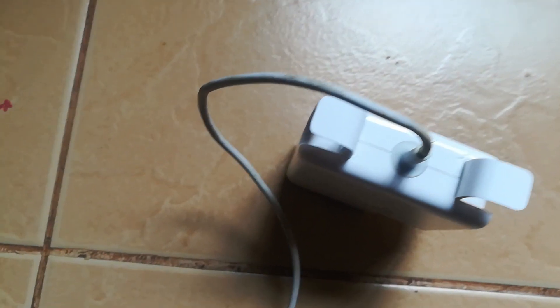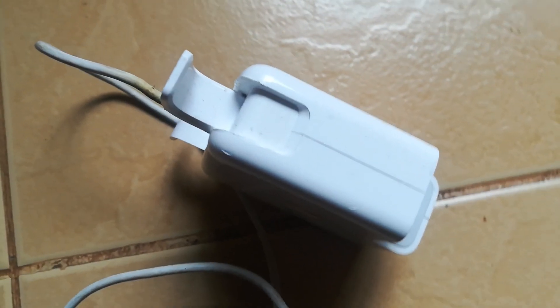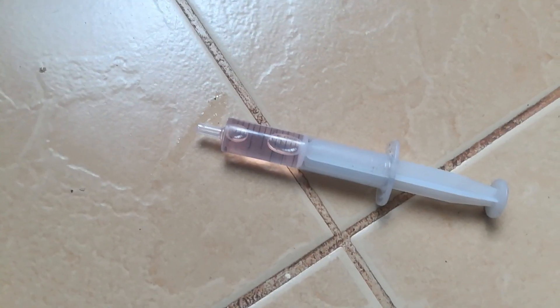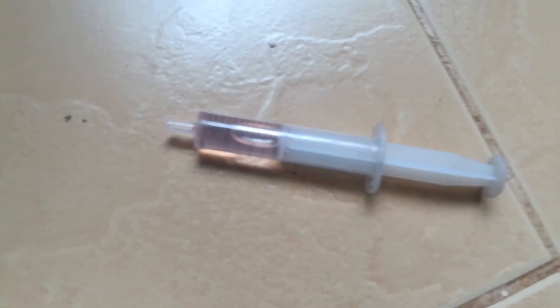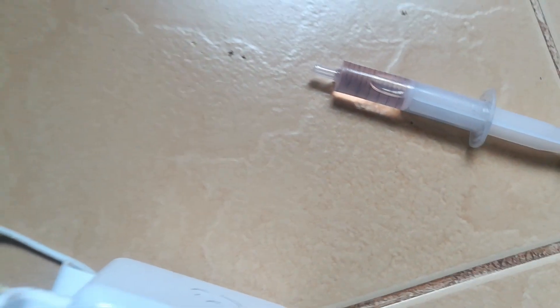The problem is I've tried to open up this charger in the normal way, pulling the casing aside, but it's too tight. Seems that they really did a good job sealing this joint, so it's not breaking apart. On this other side I have a syringe and it has some petrol inside — this is a new method I've found that works. This petrol can dissolve the seal or the sealant at the joint. So let's see if this works.